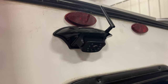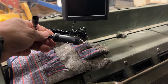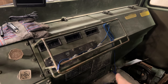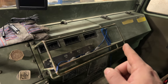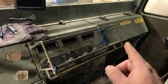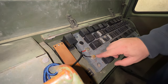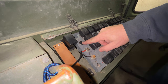Now I'm done with the camera installation — time to wire up the display in the cab. Normally you'd plug the display into the cigarette outlet, but this being a military vehicle, it doesn't have one. I did hardwire in a USB cable for phone charging. Unlike many military vehicles, this truck has an alternator that runs at both 12 volts and 24 volts, so I have both voltages available in the fuse box. In our circuit breaker box, there are a couple of places to hardwire electronics in — we have a ground, a 12-volt source, and a 24-volt source as well.